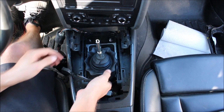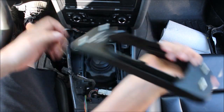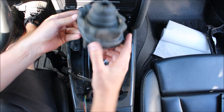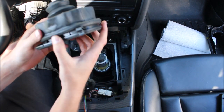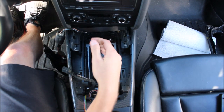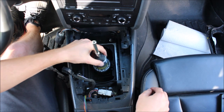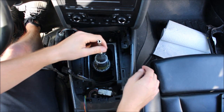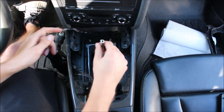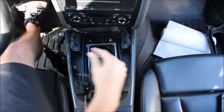The back part is loose and the front is just tucked underneath these tabs. Pull back on it a little bit and then up, and this should all come off as one unit. There are three pieces here — don't separate them, it really sucks to put back together. Now you're into the shifter. This is where I love to look at how much play your OEM shifter has — you can see the sliders moving, and when you really go over you can see the whole plate flexing. That's what we're trying to stop.